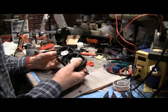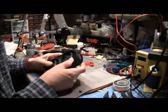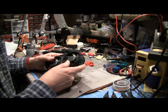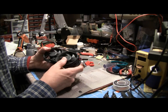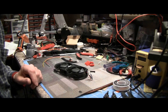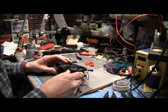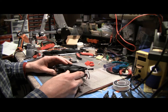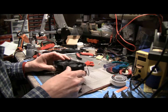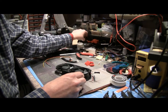One is you can control simply the GPU fan, which is your main issue, and my recommendation when cooling an Xbox is simply to boost your GPU fan with one of our fan mods, and boost that fan only, to offset the heat buildup on the GPU, which is higher than the CPU. The CPU typically never has a problem on your typical Xbox, contrary to some of the internet blogs. It's the GPU that fails, and simple logic is when you take them apart, you'll see the GPU thermal compound is all dried out and baked out, but the CPU is nice and moist and still good. So that basically tells you right there that the GPU is the one that's running hot.